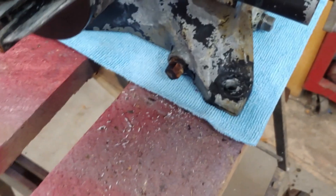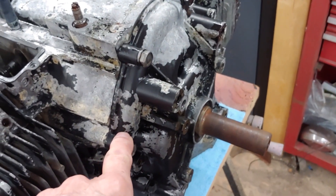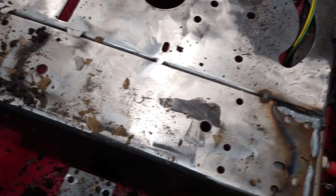I'm gonna have to drain the oil out of it and I'll probably squirt parts cleaner down in the holes to flush it out. I have two drain plugs — one here and one there — and I'll flush that out too. I haven't decided yet, but I might buy the gasket for here so I could take this off and double-check the innards. It worked fine, had no knocks or anything, so I might be cutting my nose off to spite my face if I pull it apart. We'll get it cleaned up and painted. I gotta finish my welding over here on the engine plate.